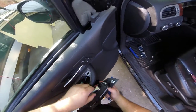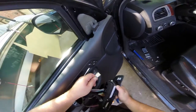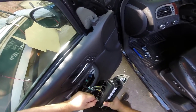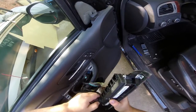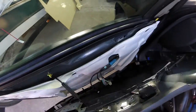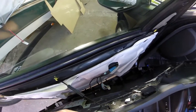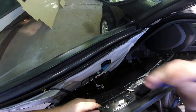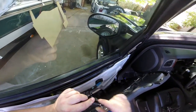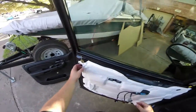Pop the door panel up out of the way. You'll see a white plug, black plug, brown plug, and gray plug — all labeled, which is nice — plus the main power junction. Disconnect all of those. The last thing holding you is the door pin rod: there are just two tabs you squeeze together, which you may want pliers for. Then gently set the door panel aside along with your tools, and take a look at what's left on the door.